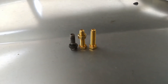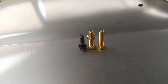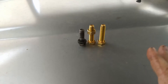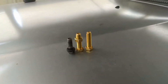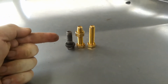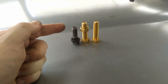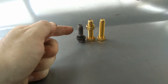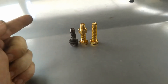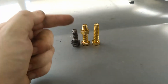You've got to be safe. You're talking about your braking system — three ton of Land Cruiser. You've got to make sure your braking system is rock solid and can pull up the car. If you know your Land Cruisers, you know your thread pitch, you know your diameter. Same if you're a patrol driver, a Hilux driver — whatever you drive, you should know your caliper mounting bolts by default. I went to about five or six different places today. None of them could get it. I managed to get it at one place — they had the right thread pitch and the right diameter, but not the right length, and they wouldn't have had the right length in for over a week. So they had this length in, and as I said, we'll cut it off, we'll deburr it, make it all nice and smooth so it's not going to get stuck in the mounting bracket.